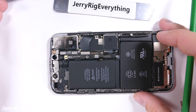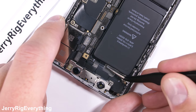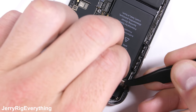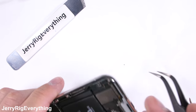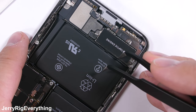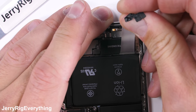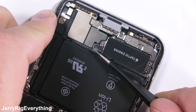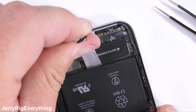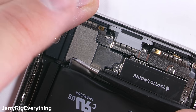Now let's take a shot at removing the oddly shaped battery. Since the screen is already off and the battery disconnected, I'll grab the first magical pull tab at the top of the battery and slowly pull it out from underneath. These are very fragile, so go slow. At the bottom of the battery there are 3 more stubby pull tabs — these are hard to get at, but if you have a pair of wide tipped tweezers that would be ideal. With needle tips, I'll just grab the edge and pull it out as best I can with my fingers. If you do fail at pulling out the magical pull tabs, you'll have to commence the pry of shame. Another trick that might help is to grab the tweezers and twist the pull tab around the tip of the tweezers to get a better grip.